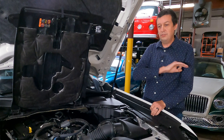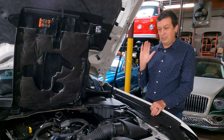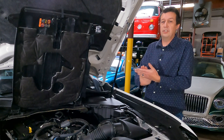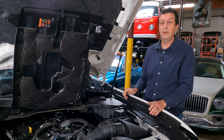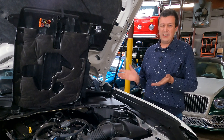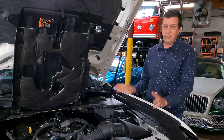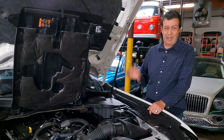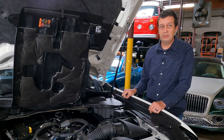If you're trying to do your commute completely on the motor, you can switch the drive mode into EV mode and it'll keep you on the electric motor all the way to the bottom of the pedal. Only if you go into the kickdown switch — for some emergency situation where you definitely need power — will it turn on the engine. This is rated at 25 or 26 miles on the electric motor. In the real world you'll typically get better than that because commute traffic is slow, and EVs are more efficient when driving slowly. I often go over 30 miles on just the electric motor.